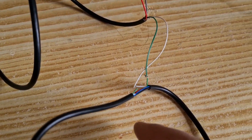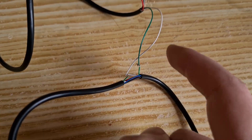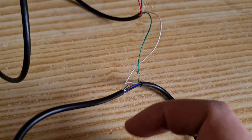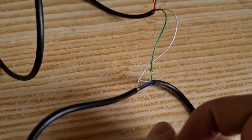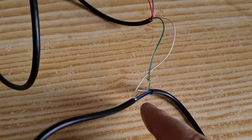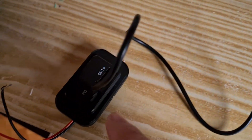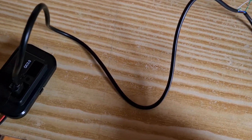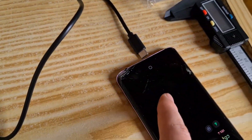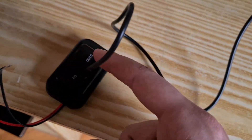This is possible because of the new USB Type-C standards which carry data through the power wires too. So basically the phone can communicate with the charger without the data cables and they can negotiate on what charging speed. This is very cool, but it also means that you must have a Type-C to Type-C cable in order for this to work. Otherwise it won't work.